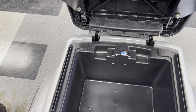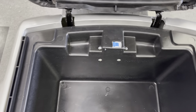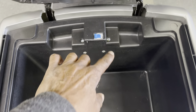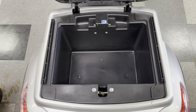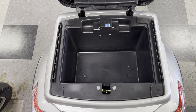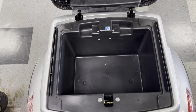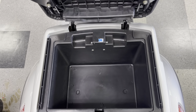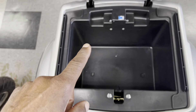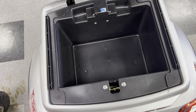Under your main trunk, you'll see a little blue button — that's your breaker. You use this breaker when you want to shut the scooter down for long-term storage, like months at a time. Instead of draining your batteries, you shut that off and it'll preserve your batteries a lot longer. If you're not planning on using the scooter for two or three months, turn that lever off to shut all power off to the scooter.